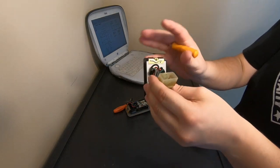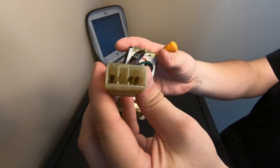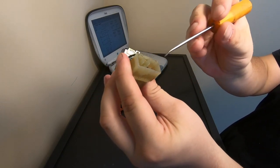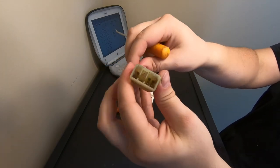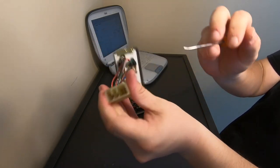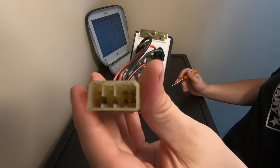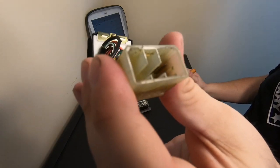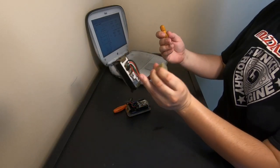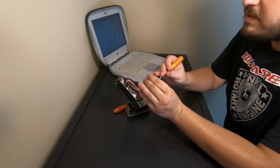If you look in the connector — which I know is gonna be extremely difficult to see — there are actually little plastic tabs at the base of each of these pins that you need to push up out of the way to release the pin from the connector so you can pull the wire out. You get at it from the front side, not the back side. Once you have your switch out of the car and look down in there, you're gonna be able to see exactly what I'm talking about. Now I'm gonna go ahead and take the pins out of this connector so I can show you how to repin the MPV switch into it.